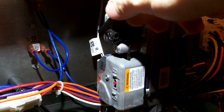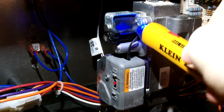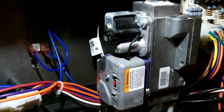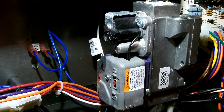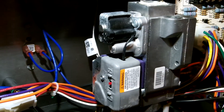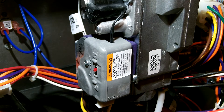It's very slightly magnetic. If we disconnect it and test again, you can also feel it hum and it gets warm — so I'm confident that's the high solenoid. Now I'm going to reconnect and switch to the low solenoid.